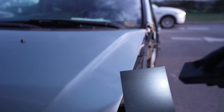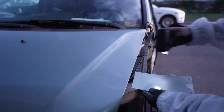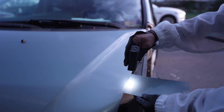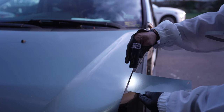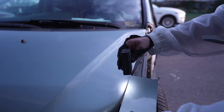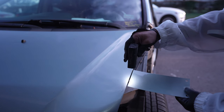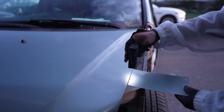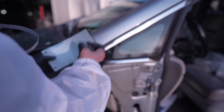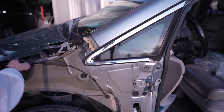We've got our card sprayed, and you can see the line of where we darkened it up with the 404 trace black — that's the go-to black I like to use. You guys can see that we did what we had to do and got this color very, very close. That's going to work perfectly for this vehicle and meet up to the hood nicely. You can see we were a little light before the 404, so now we're on the money for that panel paint. Let's check it to the post — and look at that, we've got a beautiful match for this faded-out color.